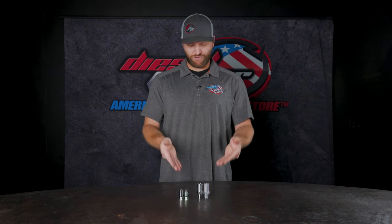The best alternative is typically doing a rail plug, or a race plug, or a pressure relief valve block-off — all of those mean the same thing, and it's actually a lot more simple than it sounds. A race plug is quite literally a device that fits in where the stock pressure relief valve went, and it just doesn't have a hole in it. It doesn't relieve any pressure — any pressure that your injection pump makes that feeds the rail, that pressure stays there.